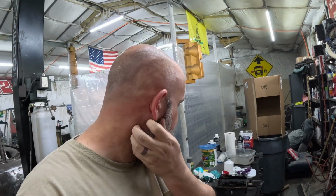So there's my recap on the paint. Harbor Freight gun did great, $15. Just make sure you clean it really well out of the box. The gun has a pressure regulator built into it. Put your own regulator on it and then open that all the way up. Turn your fan wide open and turn your fluid delivery all the way open. It did great. I mean, for 15 bucks, and $45 a gallon, can't beat it. You really can't beat it for stuff like this.